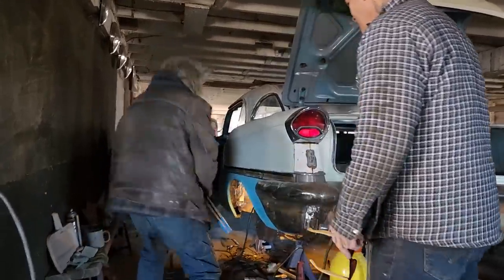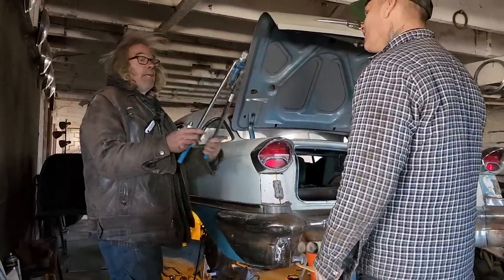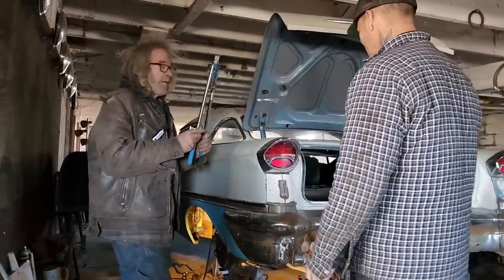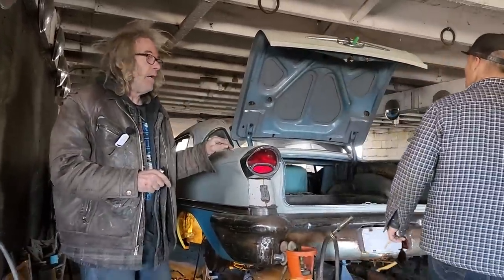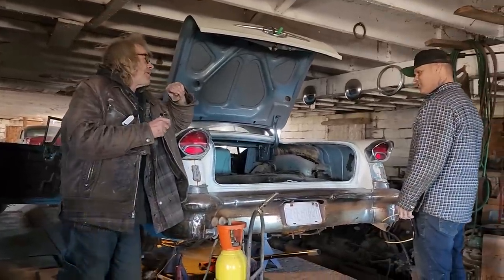And this is what you have to put them in with — oh wow — because it takes all your strength. If you happen to notice, both bars are bent, and it takes all my strength, but I'm weak as crap. Anyway, I'm getting there. I'm welding where I can but the inner fenders are paper thin and I have to use a number zero tip.